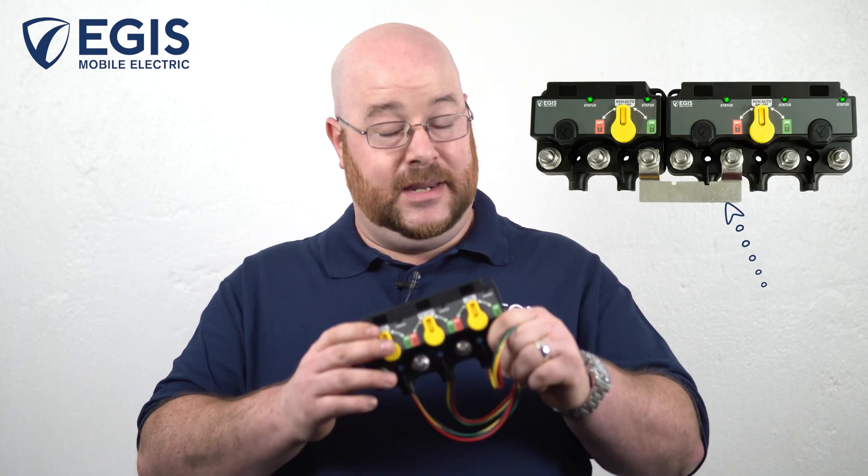Other great features are easy-to-see LED indicators that each relay has. And just look at the compact size of this thing — it contains three 500-amp capable relays and is also linkable to other XD relays with convenient bus bars to keep your installation compact. A great feature for installers are these forward-facing stainless terminal studs that make landing wires much easier and result in nicer-looking wire management.